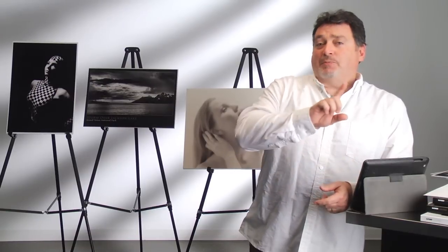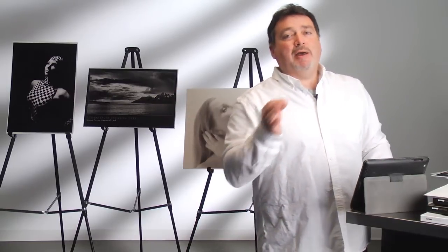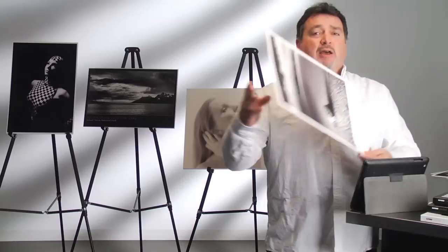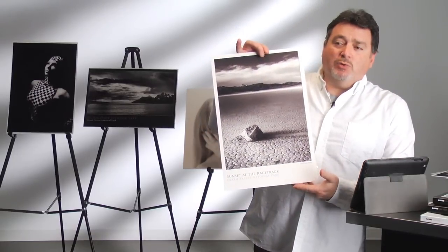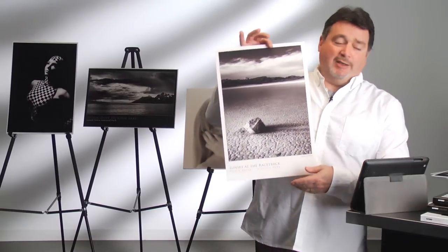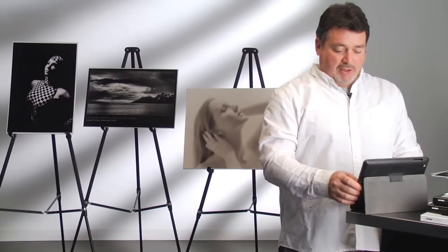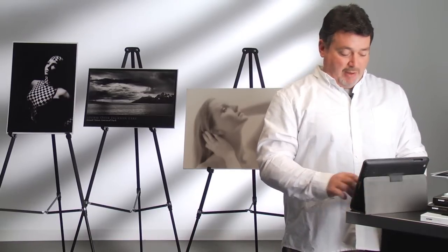If you turn off high-speed printing, the printer prints in one direction. Then the head backs up and it just prints again. So it takes twice as long, but it eliminates those lines if you're getting that. That's something you're going to see more on a gloss paper generally than on something like the gold cotton texture. But generally, I do almost always turn off high-speed printing. And I never use the highest print setting, that 5760 DPI. To me, it just blows through a lot of ink unnecessarily.